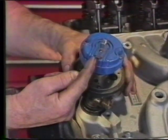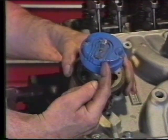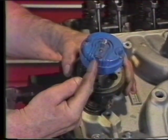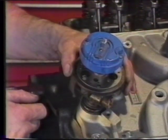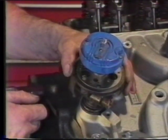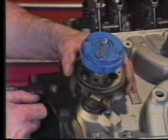Also notice that the rotor now, instead of pointing a full 180 degrees from our starting position, is slightly over. By repeating this process several times, we will move the pump shaft 1/2 tooth at a time clockwise and eventually arrive at our desired location.